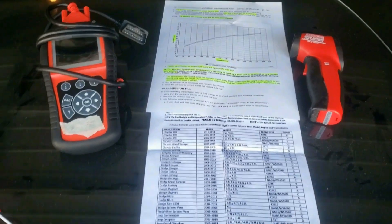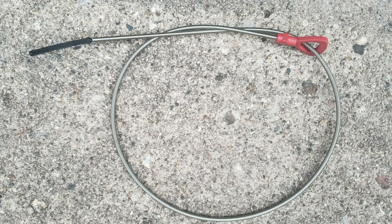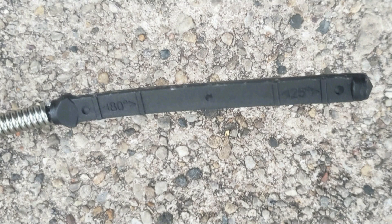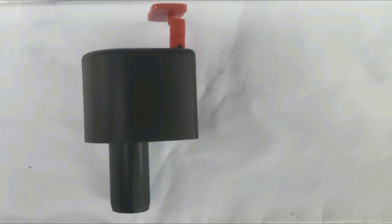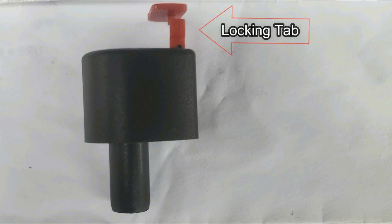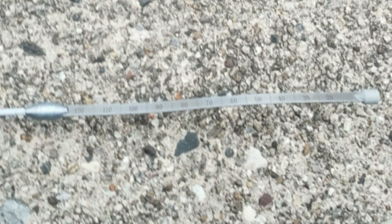You will need to buy the correct dipstick for your car. There is an actual difference between the dipsticks of the Mercedes and Chrysler Dodge Jeep vehicles. The Mercedes one uses a dipstick with a black tip and has a low and a high temperature range — one for when the car is cold or off, and the other when the car is turned on or hot. A separate trans cap with locking pin usually comes with it as well, but you could reuse the other one if need be. The Chrysler Dodge Jeep has a dipstick with numbers that go up in 10 increments, and you can reuse the trans cap.